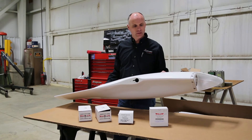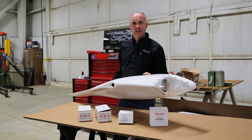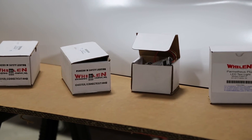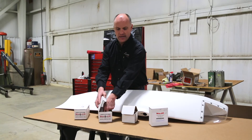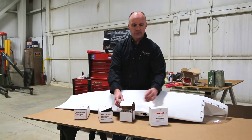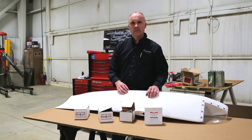One of the other Knots 2U products we'll be using on this project will be wing tips for the Piper PA-28 Hershey bar wings. This is a fiberglass wing tip with a swept trailing edge and an LED landing light at each wing tip. In conjunction with the Knots 2U wing tip, we'll be using Whelen LED lighting products — the Orion wing tip nav, strobe, and recognition light units. For the tail, we'll be using an Orion nav and strobe combination unit, and in the nose where the original landing light was, we'll be using an LED taxi light, used in conjunction with the wing tip landing lights and the pulse light system.